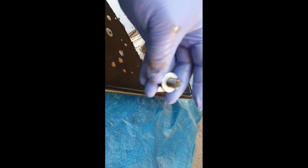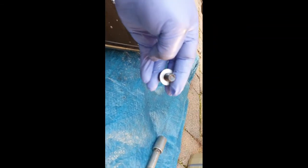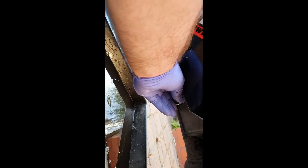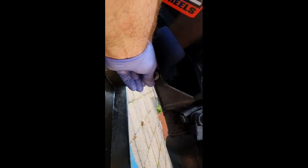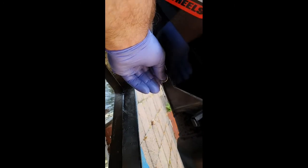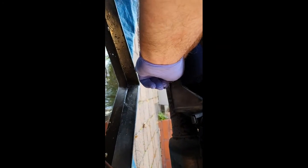And sump plug still sort of draining out slightly, but when you get your sump plug, make sure that you put a new washer on it. Nice clean washer. And it just screws in, but it allowed all the oil to come out. Now there's literally just drips coming out of this now, so go ahead and we'll put the nut back in. Again, try and do it with two hands. And we'll tighten all that up then before we put the oil in.